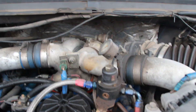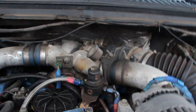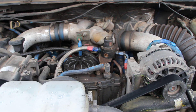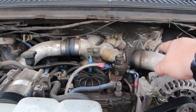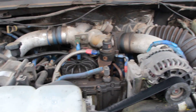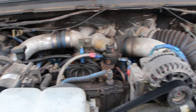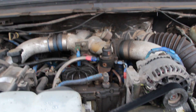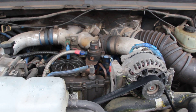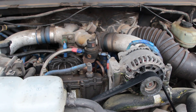So the way you do this — first let me explain the problem. The problem is on 7.3 liter diesels, you get what's called cackle on occasion. What it is is an improper fuel charge delivered on the number 8 injector at the very back of the driver's side. The number 6 injector is in front of it. All the evens are on the driver's side, all the odds are on the passenger side. They fire sequentially in the firing order of the engine — 6th and 8th. Well, they're fed from the front of the engine. Part of the problem with the way the fuel system was implemented by Ford is that there are connectors in the fuel system that allow air infiltration from pre-pump.